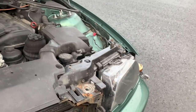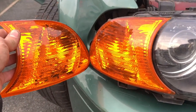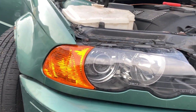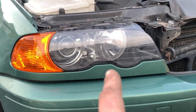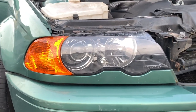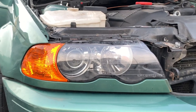I can quickly swap that indicator now and then do the same on the other side. I want both brand new ones in. I brought the new indicator up and, even the tags on the bottom, these are non-genuine but they look exactly the same — they fit perfectly. So I wouldn't bother with genuine unless you really want to; non-genuine is perfectly fine. I've also moved the headlight over slightly so it fits in that gap a bit better, because the rolled wings have been pulled out quite a lot. This little hockey-stick piece also needs to come out for the extra clearance on the headlight. Quick, easy ten-minute job: bolt, bolt, bolt, pop this off, unclip, and you can do this on your driveway.